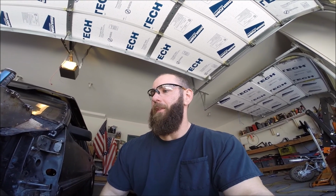So I'm going to start off with a 3-inch lift in the front of the car. So after I get that upper bracket welded in and then the lower bracket welded in, before I cut the chain and actually bolt it all together, I'm going to jack the front end of the car up, measure it ahead of time first. I'm going to lift it up 3 inches, so it'll basically simulate 3 inches of rise in the front of the car, or 3 inches of suspension travel. And then I'll stop, I'll hold it there, and then that's where I'll cut and attach the chain.